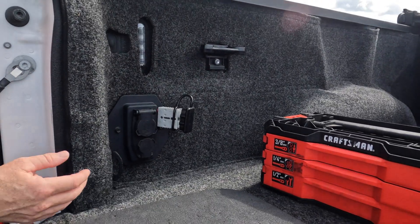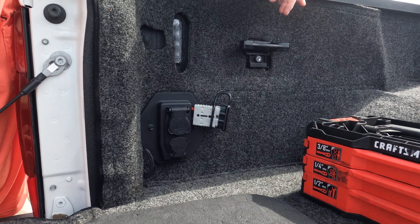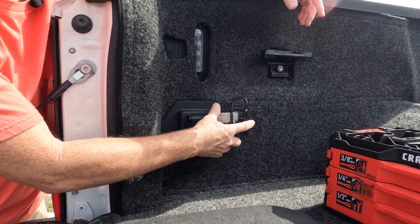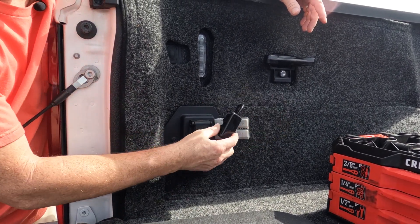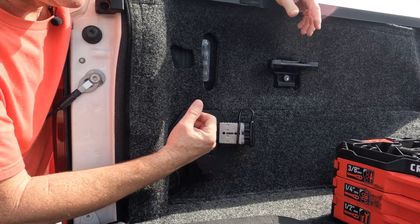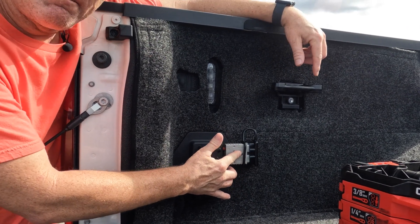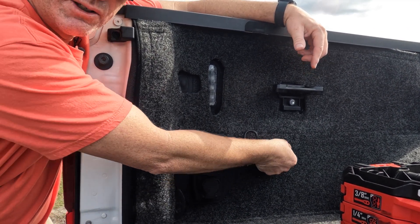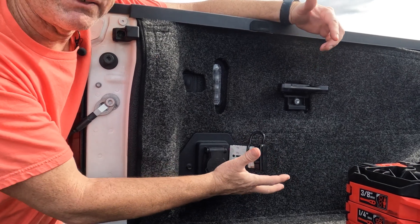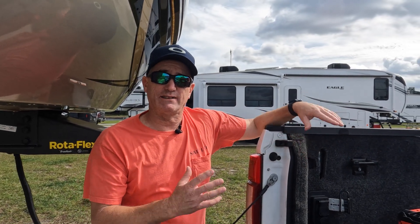This is the Anderson plug — this guy here. This is a factory plug. I drilled two holes right here with a 29/64 drill bit to catch the gauge of wire just right to go through. We did buy caps — these nice rubber caps, about 10 bucks. The Anderson plug was about 20 bucks. All this stuff will be linked in the description. We had a rigid mount, but we were struggling really hard to plug and unplug the cable from the trailer, so I just pulled the screw out and left it loose. This works for us, though your application might be a little different.